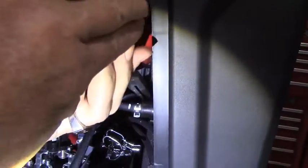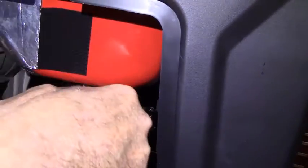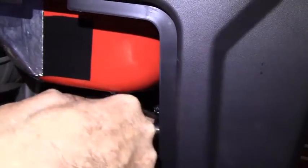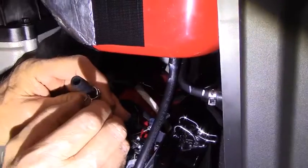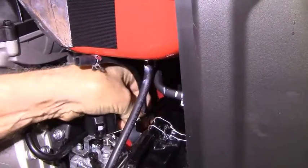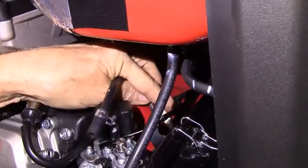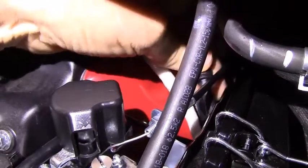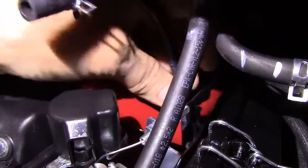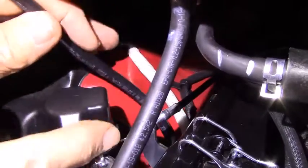And what you do is you squeeze onto 2 little tabs and just wiggle the hose back. And then I'll slide the hose off of that port. So there's your Corbin clamp right here. You'll notice that there is a protective O-ring that goes in this groove. Can you see right where my index finger is? You see this tab on the air filter? Originally this was right here holding it in place. You're going to slide it out of that groove because now the fuel hose is going to run straight up. So that can run down and just lay next to the carburetor and you're fine.